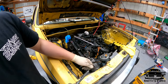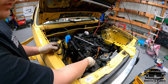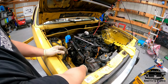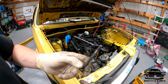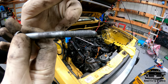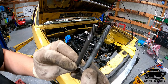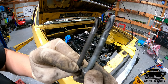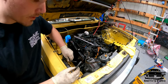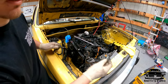Quick note on the alternator bolt: the regular bolt goes right there but it's a bit too long, so you can't physically get it in because of the frame rail on the Mark 1. I found a random bolt — I didn't want to cut the original down, and you can see that one has been over-torqued and is really thin in the middle, so it was about to snap anyway. Held up next to each other, I took about 10 millimeters off. Now this bolt will actually go in, and I can thread it in and get good thread engagement.